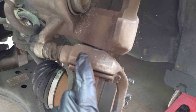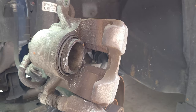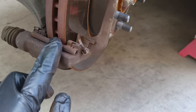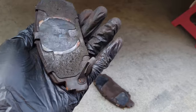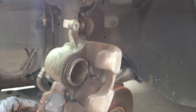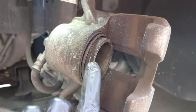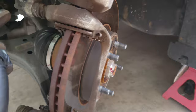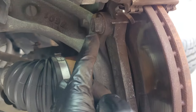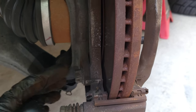There's a good amount of brake dust buildup — in Southern California this is a lot; in other areas it can be typical. We'll clean some of this off. That's why you want a mask and eye protection — it's very fine powder and you don't want it in your lungs. The brake pads have definitely served their use. Keep one old pad to use for compressing the piston when we're ready to reinstall. Before compressing, clean all this brake dust so it doesn't get pushed back into the brake system. To access the rotor, remove the additional 14mm bolt, plus the two 17mm bolts — these will be more difficult, but we have a breaker bar.